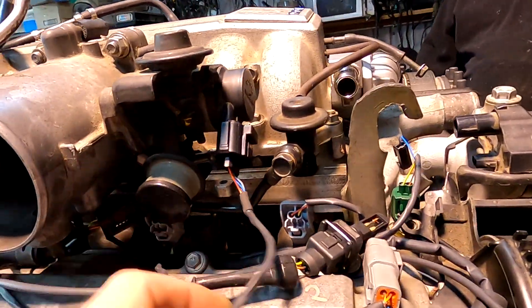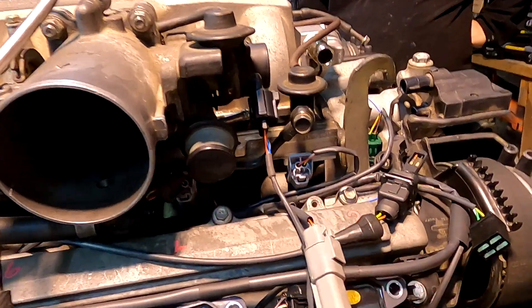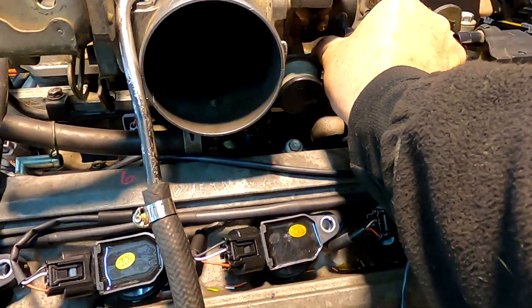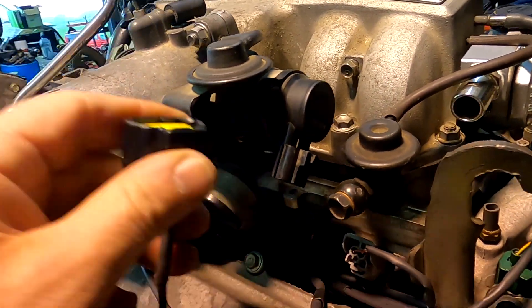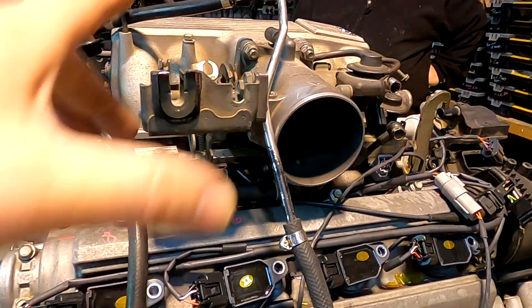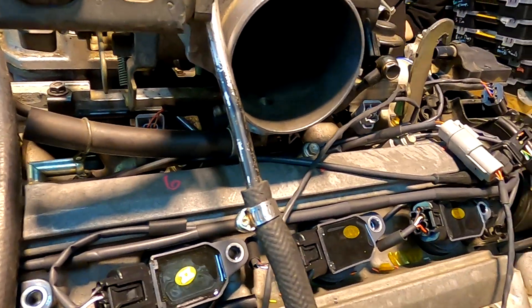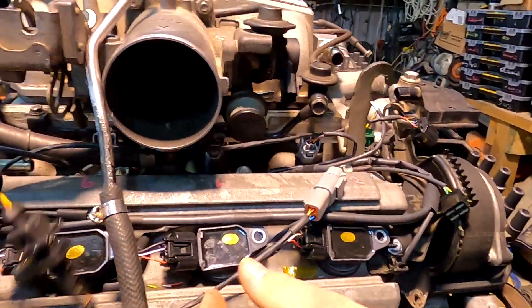Without having the vehicle here though. Now if we look here — there's the four pin plug for the TPS, making the TPS lead really long. There we go — he's made it so it can come out. We often remote the throttle bodies on a Hiace van, so he's made the TPS to suit. We make up this bit of a — we call it a gonzo tube. The tube comes out but the air intake sensor still fits in that tube, or otherwise it fits in a fairly normal position.